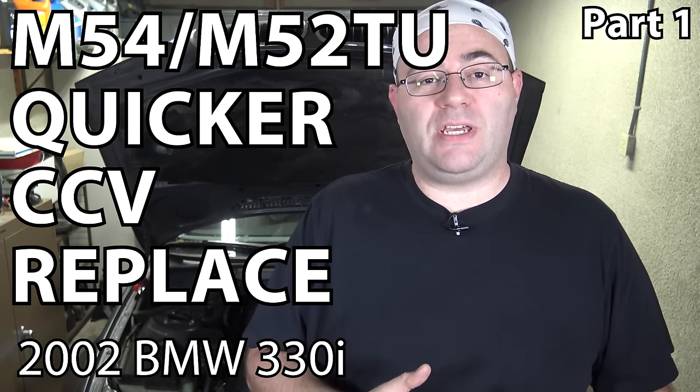In this video I'm going to show you how to change your CCV system, which is the PCV system on an E46 BMW. This also applies to the E39, E83, and E53 — anything with the M54 or M52 TU style engine. The CCV system wasn't very well engineered. It's located underneath the intake manifold, the plastic becomes brittle, and the lower hose that leads from the oil separator down to the dipstick tube will crack with age, causing a massive vacuum leak. The system can also clog up with a yellow mayo-type substance depending on how cold a climate you're in.